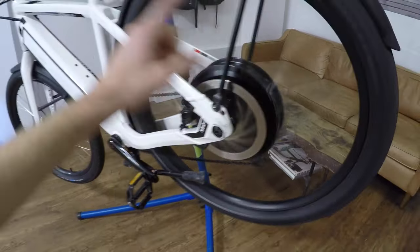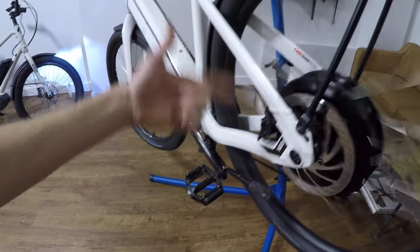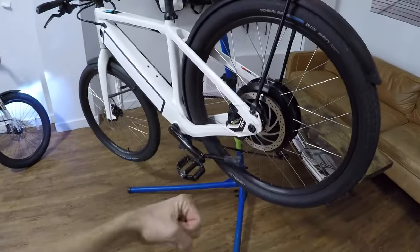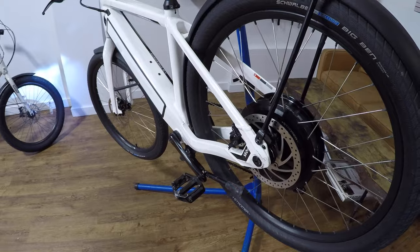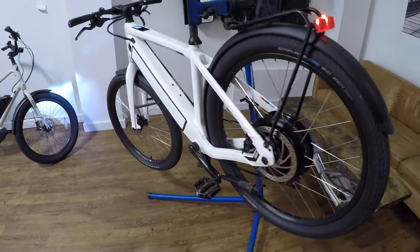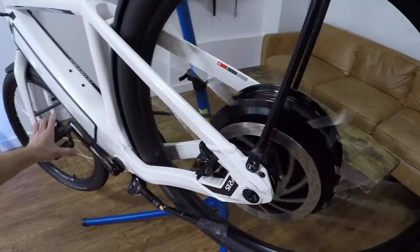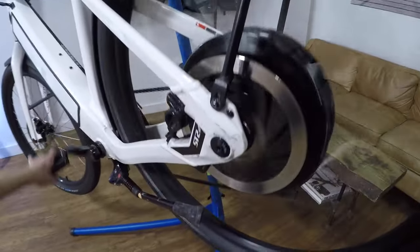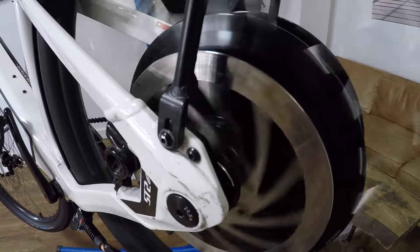There we go. Did you see how at first it was just me pulling on that about half a rotation, and then it caught? It was listening to that signal and it said: okay, that wheel's moving, the person's pedaling hard, we're going to give them some assistance. And as soon as I stopped, the system cuts out. If you don't put in a lot of force, the motor doesn't kick on — it's proportional. As soon as you add power, it gets up to speed, just like if you were riding a traditional bike. You can even hear the regen, kind of that hum going on in there.